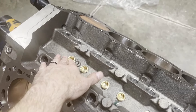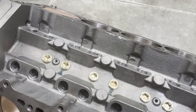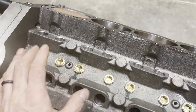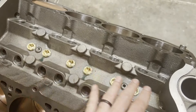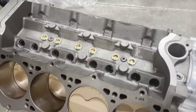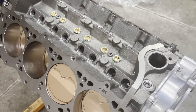If there's any oil up here, we're going to scavenge it from our intake manifold. In later videos I'll show you how to do that — we'll run an extra stage on our dry sump pump and pull from a tube that goes behind our intake manifold, hanging down about like this. That'll catch any oil that puddles up. Most importantly, it'll pull vacuum on the top end of the engine since it's blocked off and segregated from the bottom end. The scavenge lines from the dry sump oil pan will pull vacuum from the bottom, and this line will pull vacuum from the top — a little extra horsepower to be found there.